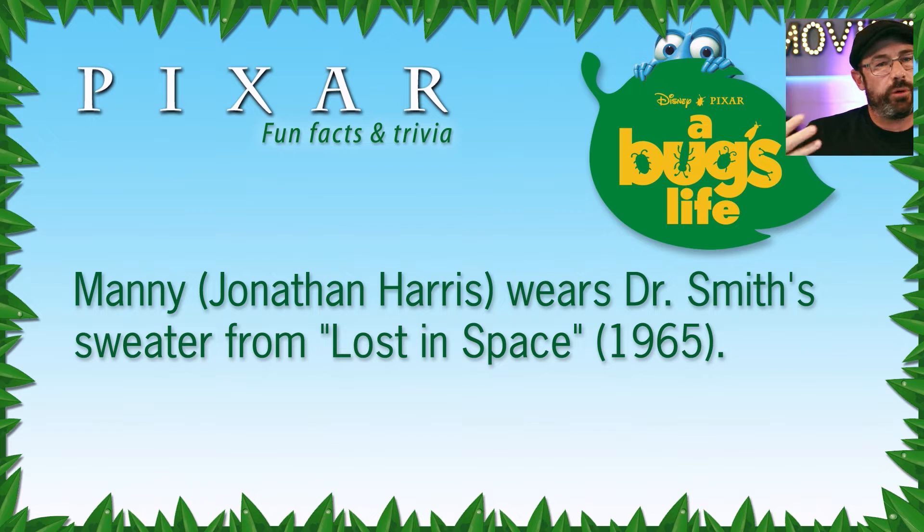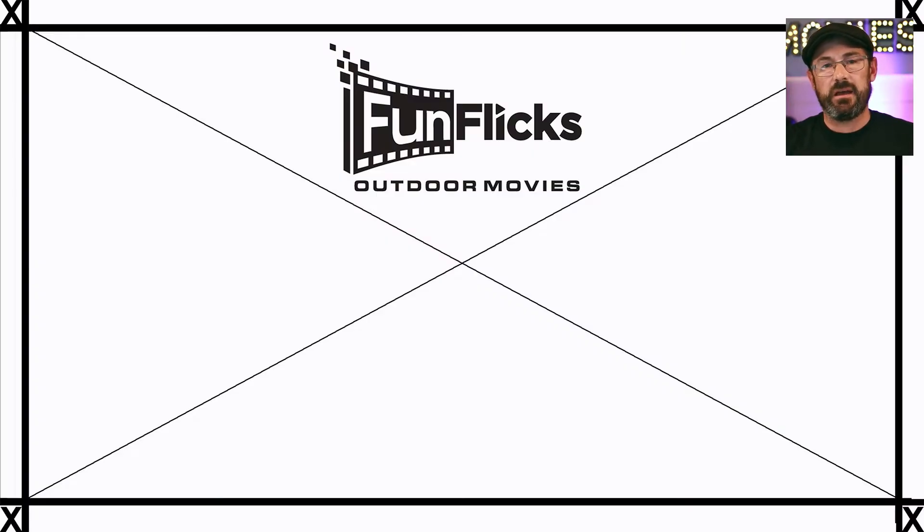Say for whatever reason ProPresenter or PowerPoint crashes — I'm going to simulate that by turning the display off. Whatever you have your background image set to is what's going to be displayed. If you're doing a presentation for a movie night, you can have the event logo set as your desktop background. Save it to your PC as a 1080p JPEG, right-click on that JPEG file, and select 'Set as desktop.' That way if any app crashes, instead of seeing a messy desktop, they'll see something related to the event. You can even make it a black screen, though you may want a pixel in there so you know it's not a disconnected cable.